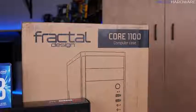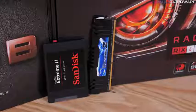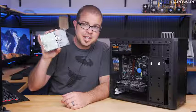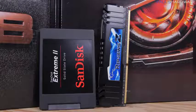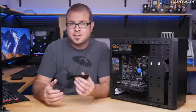The case is a Fractal Core 1100, a budget micro-ATX case at $40. For storage I have a 240GB SSD — a SanDisk, comparable speed-wise to the A-Data one from the original parts list. I highly recommend an SSD for your OS, but one of the first things you might add is more storage; ideally salvage a 1TB hard drive from your old computer. For memory, just a single 8GB DDR4 stick — an easy future upgrade would be adding another 8GB stick for dual channel.